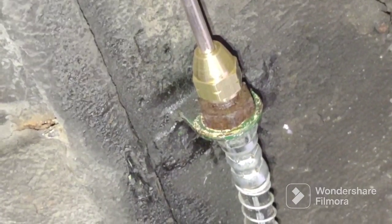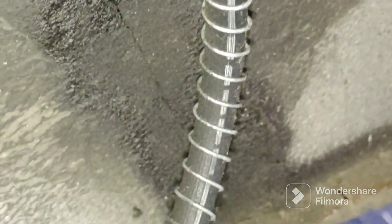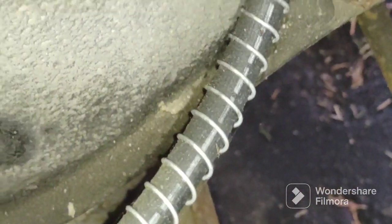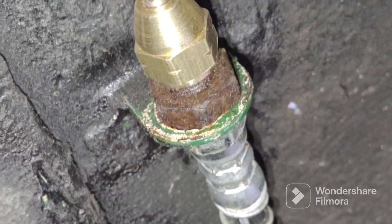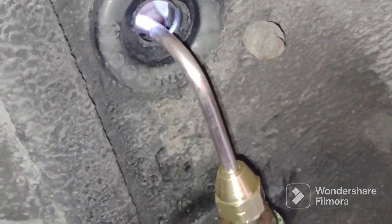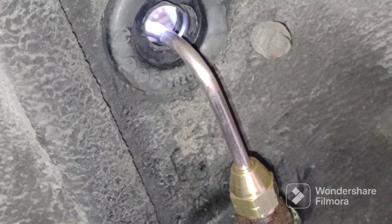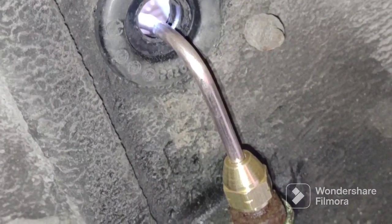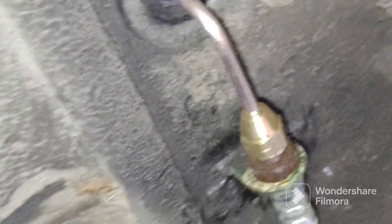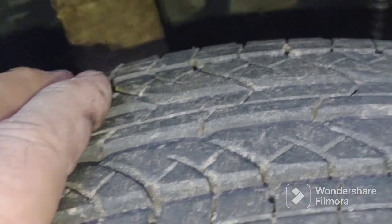Can't believe that rust to the right — I just bought those lines a few years ago. Just surface rust I guess. But this is on perfect, everything's tightened up. The only thing left is the bleeding. On a left-hand drive car, I think you go right front bleed first, then left front, then right rear — I think there's just three.